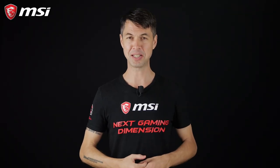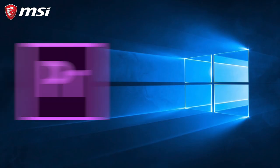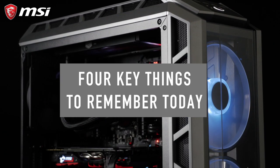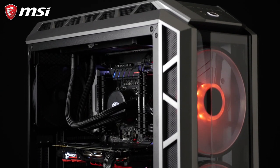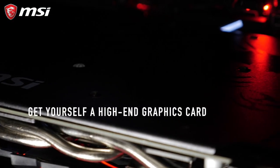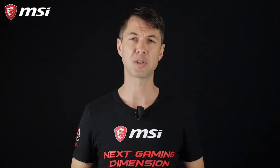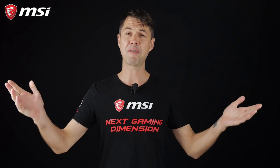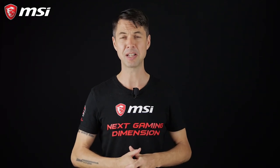Our video editing PC is complete! Make sure to quickly visit your motherboard's BIOS to enable XMP on your memory, and you are good to go. Install your favorite video editing software and you are rockin' and rollin'. There are four key components to remember: one, pick the right components to fit your production aspirations and budget; two, a fast multi-core processor is key; three, get yourself a high-end graphics card; four, don't underestimate your storage needs and plan for backups. Let me know in the comments what video editing software you prefer and what specs you use. Thanks for joining us — if you liked it or learned something, give us a thumbs up. Thanks for watching and happy editing!